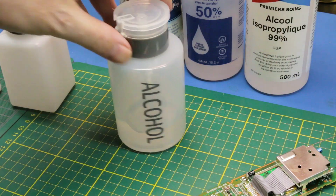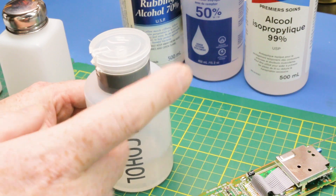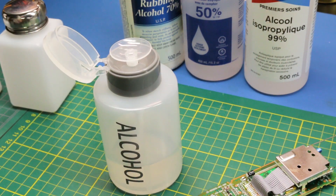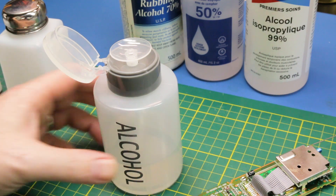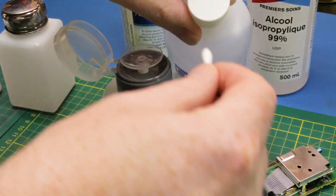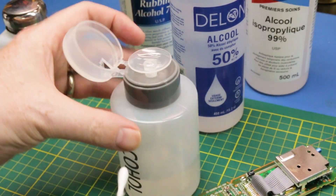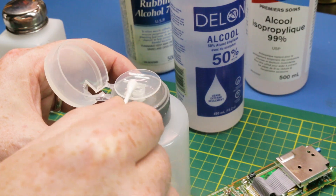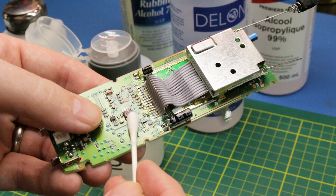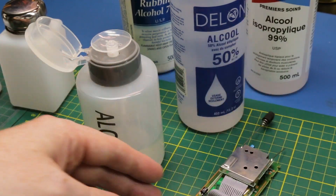But here's the tip. The handiest thing is to have your cleaner in a pump. I got this one on Amazon — I'll put the link in the description below. When you go to use a q-tip or something to clean with, rather than having to uncap the bottle and dip it in, you can just pump the pump here and you'll notice there's a little bit displaced into the top. Now we have our q-tip ready to go and we can use this on any corroded terminals.